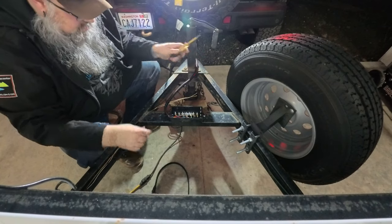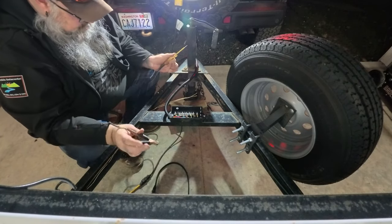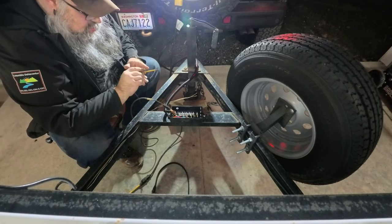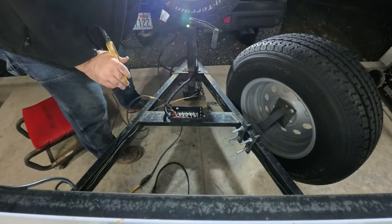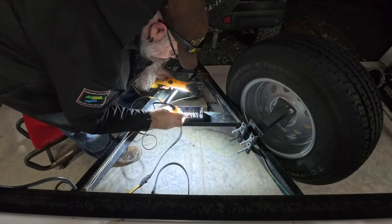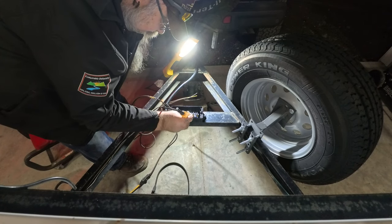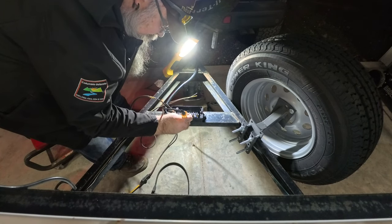So, all right. After an extended intermission, because I dumped my connector box and picked up 1,000 gajillion pieces, I went ahead and got the Jeep backed up. I got it hooked up. I'm just going to verify our lights are what they say they are. So I got a black wire here, and apparently it's battery hot. So we're looking for left turn right now, which apparently is a red wire in this harness, which doesn't make any sense, but okay.